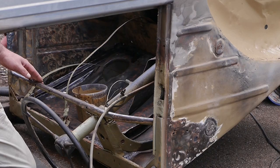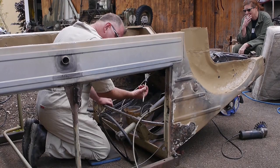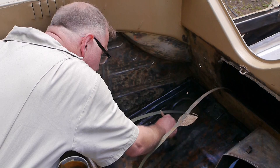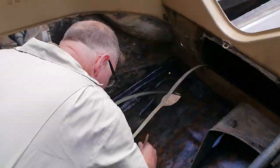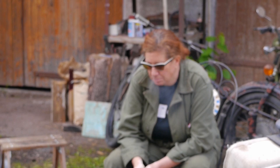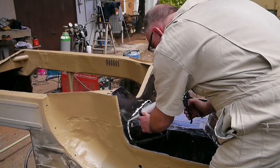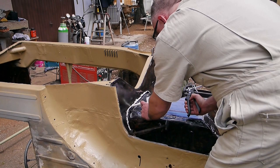Shortly after, Franz Josef began coating with Brunox. 'What, those bristles? Real bristle quality?' Yes. What a mess. Time was given for it to react with the metal. This scene has a touch of Ludolf about it. In the meantime the Brunox successfully reacted with the metal surface – you can see it beautifully in the dark discolouration. As the next step, sealant was applied to all the weld seams.